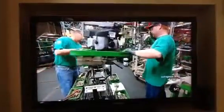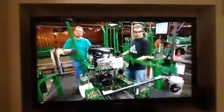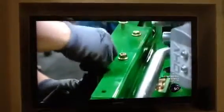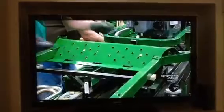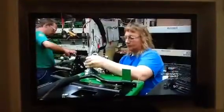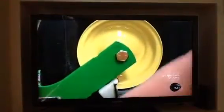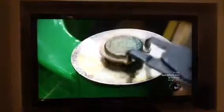They lower the engine sub-assembly into position to build the vehicle framework around it, then bolt the welded and freshly glossed side rails to tubing at the front and back. They attach the footrest to the frame, then install the platform for the seat. They assemble those nifty steering levers, which can be moved into 15 positions. Then they install metal yokes on the front wheels, slotting the yoke shaft into the frame rail and securing it with a metal snap ring.